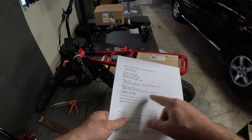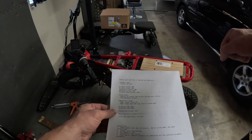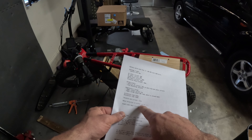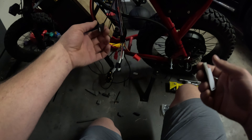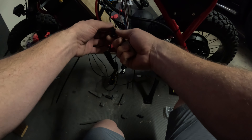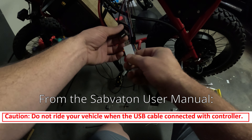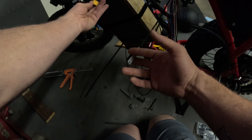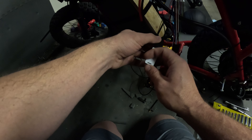Throttle mid current is going to be 125 amps, which is based off the max phase current, so at half throttle we'll have more than half the amperage going to the motor. Motor direction — I think it's going the right direction at zero, and we could reverse it by switching it to one. We're not going to have a limit for the speed mode. The controller has a little USB connection that's always attached to it, and there is a Bluetooth module you connect to it. I believe we have to connect the battery and turn on the display before the Bluetooth module will be enabled. I haven't been able to get this to work so far, but today we're going to try and do it together.